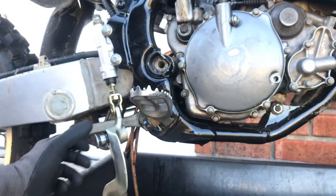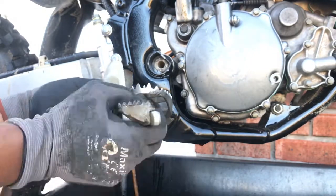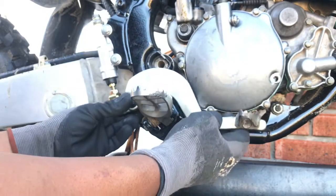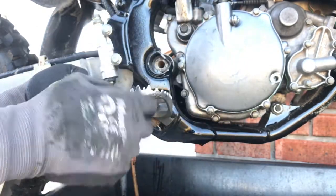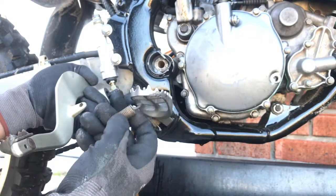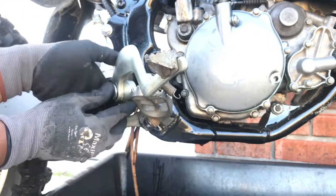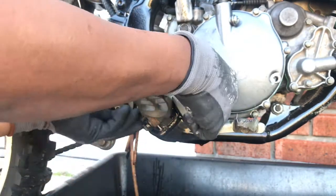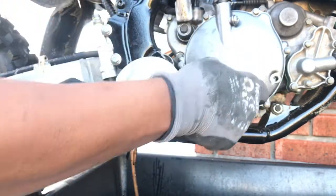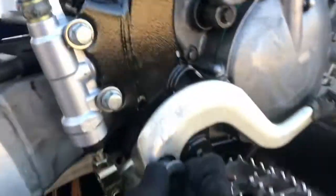Let's get our brake lever installed back onto our bike as well. That's gonna wrap around the top side of our foot peg. You see this spring right here? This spring is gonna hook right up in here. So let's get him hooked in place. Okay, we got our spring on, got our brake lever. Start my bolt by hand.